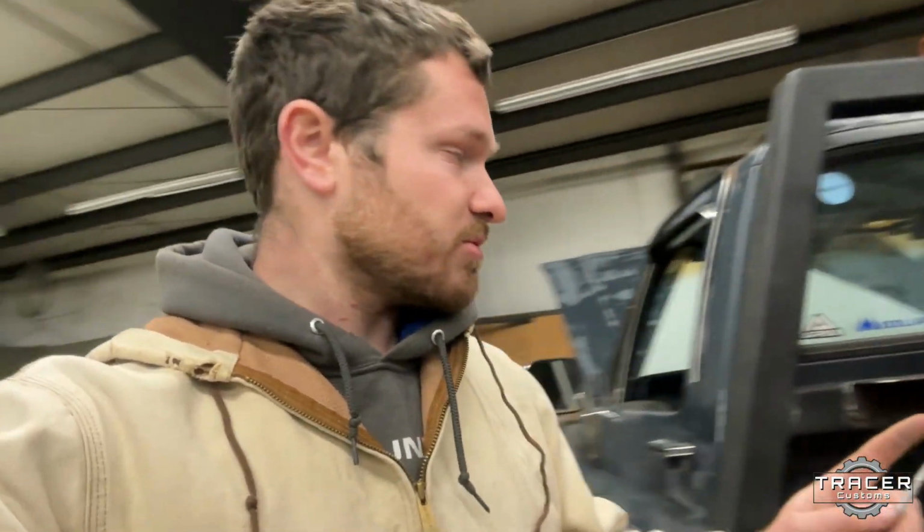All right, can't find the rivnut kit. So I'm going to use some self-tappers, but this is temporary, and Tim's not here to complain about me calling something temporary that might not be temporary. Well, it is temporary. It just might not get replaced till it's a problem. Self-tappers aren't the best here because they're going to get loose eventually with all the rattling, but we'll fix that later. So it's going to be temporary just to hold it down because I need to get this ready to go